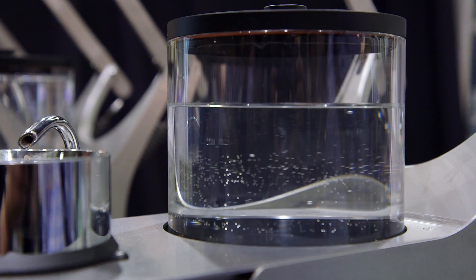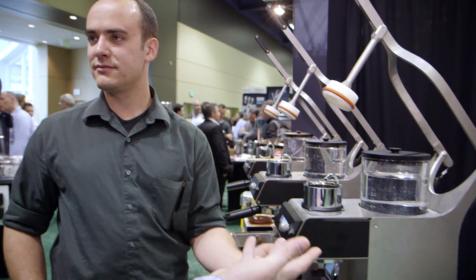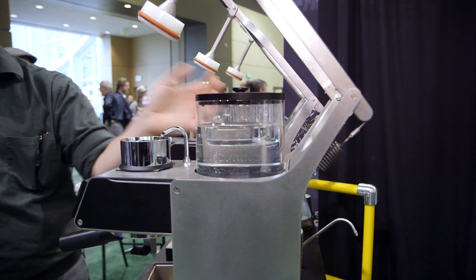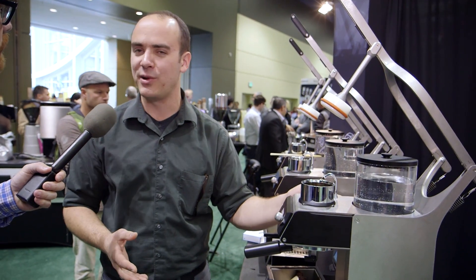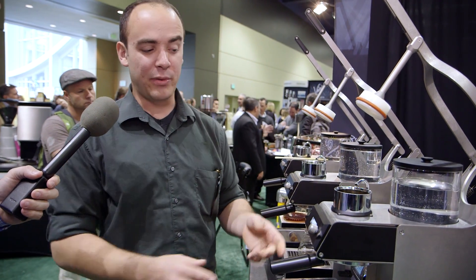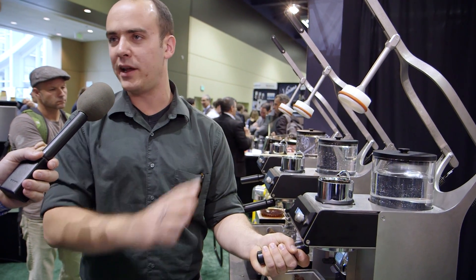You've got as close to an isothermal environment as possible — not just the tube, but also the portafilter. And yes, you're also heating the water before it goes in. All of these brewers ship with a glass window on the back so you can see the high-precision guts. There's a PID-controlled boiler back there, but this is the only brewer that also has a PID-controlled thermally heated brew group that maintains single-degree Fahrenheit precision for any brew time.